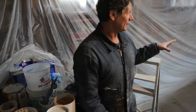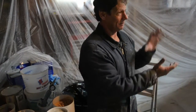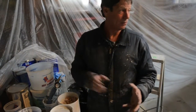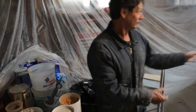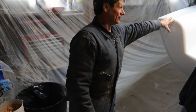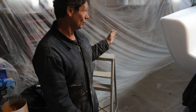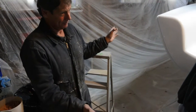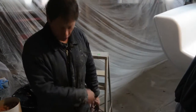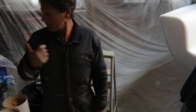There's kind of a common rule where you can't put polyester on epoxy, but you can put epoxy on polyester, because of what they call an amine blush. All the gases rise to the surface, and this shine on epoxy would be an amine gas laying on the surface that affects everything. But they've since found out that you can remove the blush with water. So you could wash your vehicle with water, just hose it nicely, clean it off, and you can put gel coat on it.